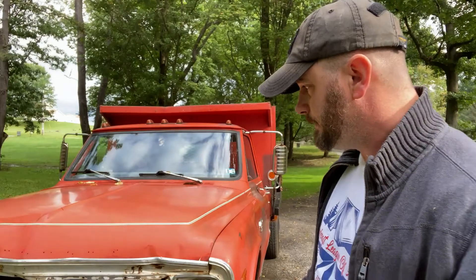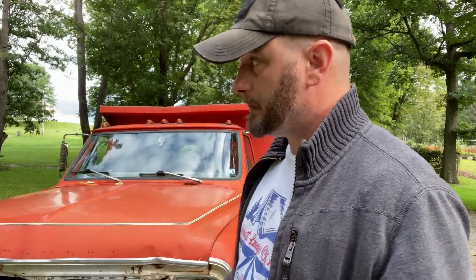When I first picked this up — and I've been enjoying driving it for the past couple months — it had a hesitation while running and was also running really rich. Step one: learn how to read spark plugs. If you go to buy a vehicle and ask the owner if you can pull spark plugs to see how it's running, especially if they mention problems with it, and they say no — walk away. It's that simple.